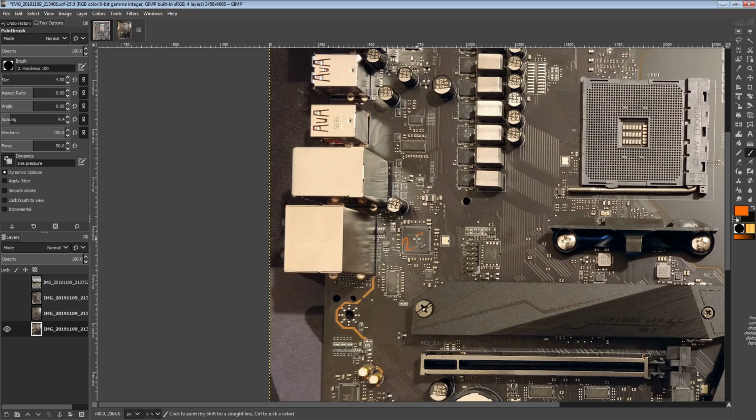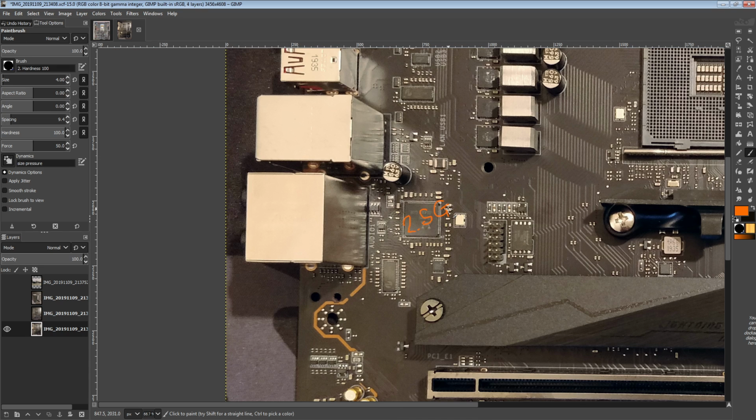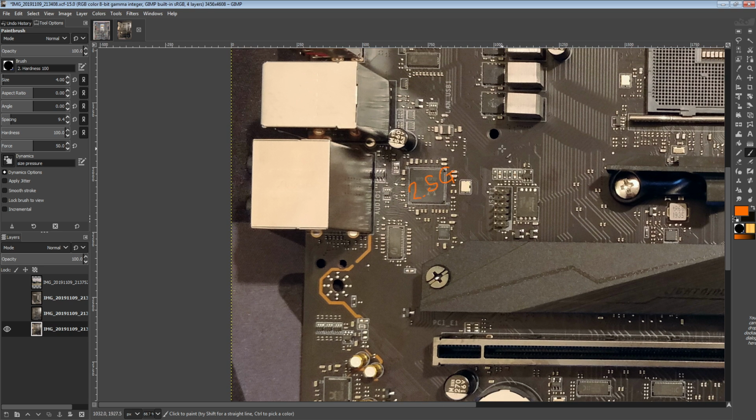And then we've got 2.5 gig Realtek LAN. And this is kind of where I wish you had just kept the 1 gig Intel instead, but hey, maybe Realtek LAN isn't as flaky as it was when I last used it. And by flaky, I mean it would drop out every couple tens of hours, and you fix it by restarting the drivers. That's not really that big a deal, but the Intel LAN never did that to me at all. Intel's LAN drivers are at the very least far more stable. But maybe Realtek has improved the driver situation, and that just doesn't happen anymore. In which case, 2.5 gig is more than 1 gig.